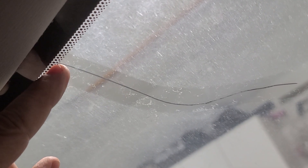Unlike most other videos where there's a suction cup apparatus you use to put pressure and get the resin in, in this case we're going to use a capillary effect and hope that the resin will seep down into that crack and get through the tempered glass on the outside to the plastic on the inside. This resin is UV stabilized, so we're going to do this inside the garage and then pull the car out into the sun when we need it to set.